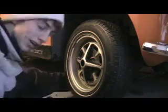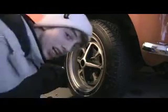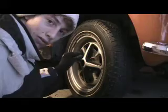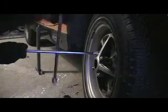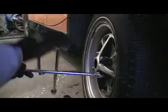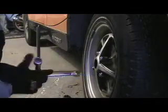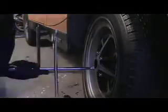And now this is really important also, but it doesn't really matter with mine because I have 4 lug nuts, but I usually skip one when you put them on so the wheel's straight and you're not running down the road looking like you're drunk. You gotta tighten the lug nuts on there. Make sure you skip one, but it doesn't really matter because there's 4 lug nuts on mine, and you usually skip one on most vehicles so your tire's not going crooked and cockeyed.